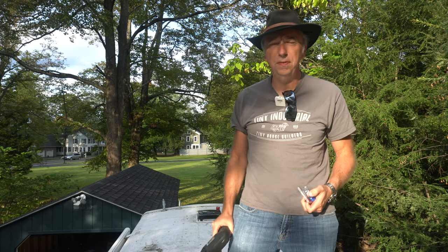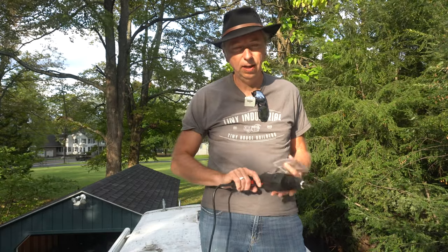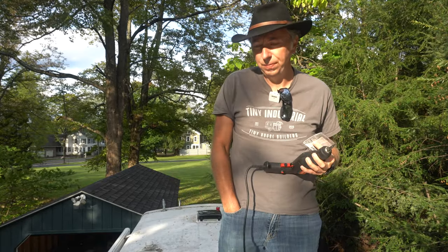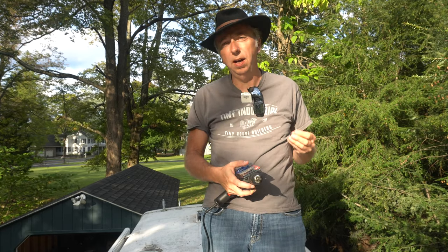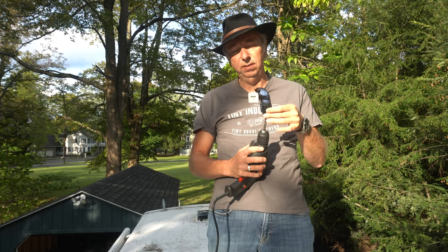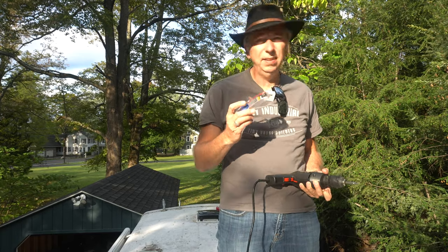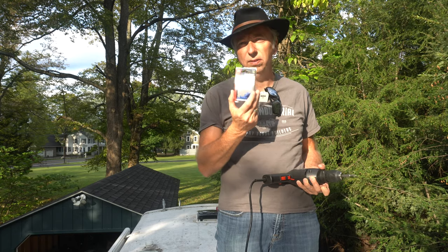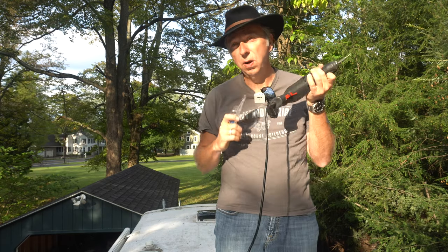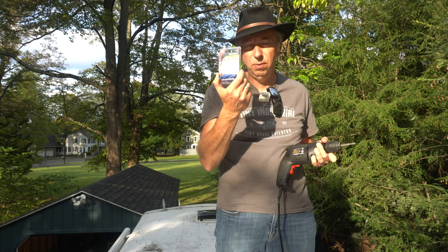All right, so as is often the case, things are always a little bit trickier than they maybe at first appear to be. I realized that I'm not gonna get the screws into the fiberglass without a drill. And the other part is the screws that come with the new lights are not self-tapping, but that way I can just drive these in with a standard Phillips head bit right there. The other thing is the lights come with these little plastic clamps that clamp over the wires and make the connection that way. I got some more of these twist-on wire connectors in the proper size. So add this piece to the collection of tools that I showed you earlier. And, you know, throw in these, good for good measure.